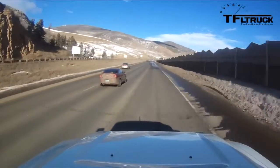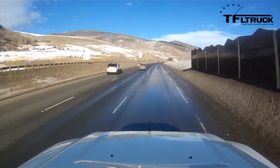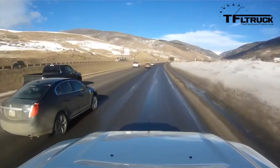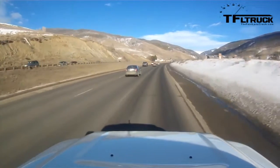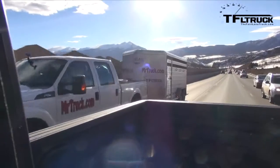Now, this truck is normally aspirated, so we don't have a turbo to help us because we are at about 9 to 11,000 feet above sea level. And this is a very extreme test of a truck's ability. Maybe not this truck's, but the normal truck's, because we're going to 11,000 feet at the top of the Eisenhower Tunnel, and that means about 30% less air density, which means, what, gentlemen, we know it by now? Less horsepower. And these normally aspirated engines don't benefit from a turbocharger.